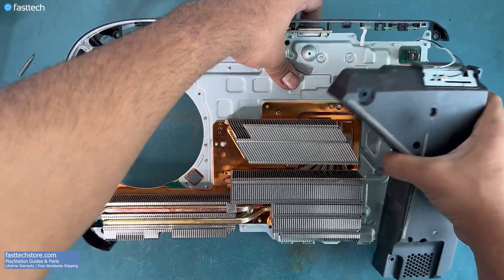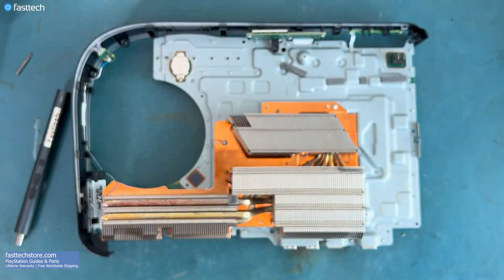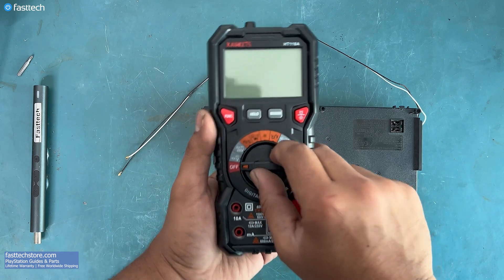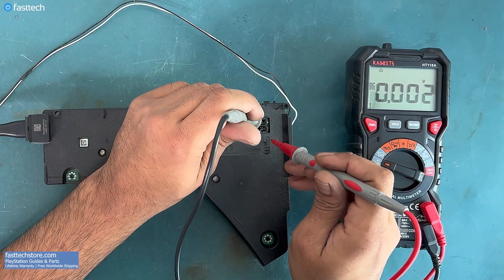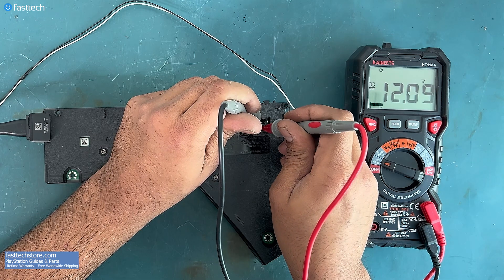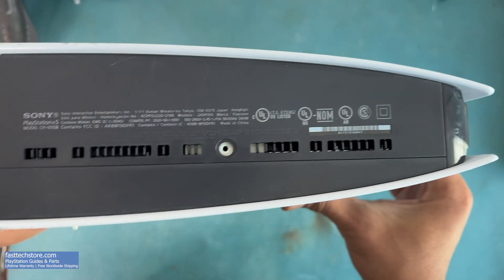Let's push this piece up and get the power supply out. I'm going to demonstrate how you can test to see if your power supply is blown. We're going to need a multimeter set to volts to detect voltage. Plug in the AC power cable to the power supply and use the two probes to test for voltage. A non-working power supply would output zero volts, while a working power supply should output 12 volts. This is how you find out if you have a faulty PS5 power supply.